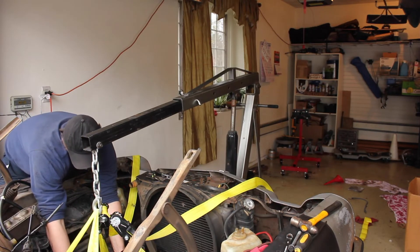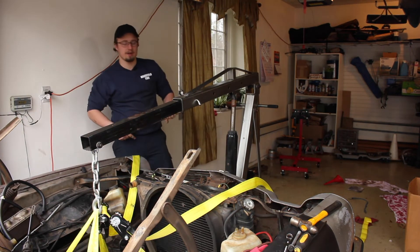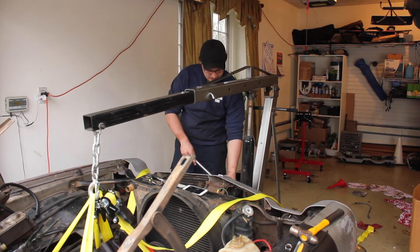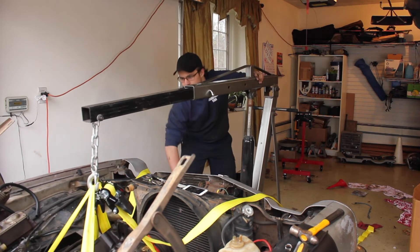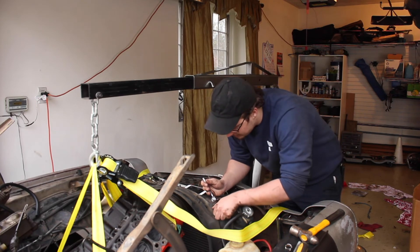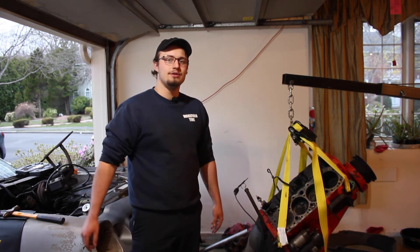Now I'm taking out the bolt on the other side — nice and easy. I've already disconnected everything else including the trans mount, so I should be ready to just start lifting everything out. It's going to take a bit of finagling as you're trying to get this thing out, but it should come out pretty easily. One thing you should do — which I forgot — is remove your fan shroud before you start taking out your engine. It'll give you more room to maneuver. With just a little more finagling and pushing, you should be able to slide your engine and trans right out of your car and you're on your way to rebuilding that engine.